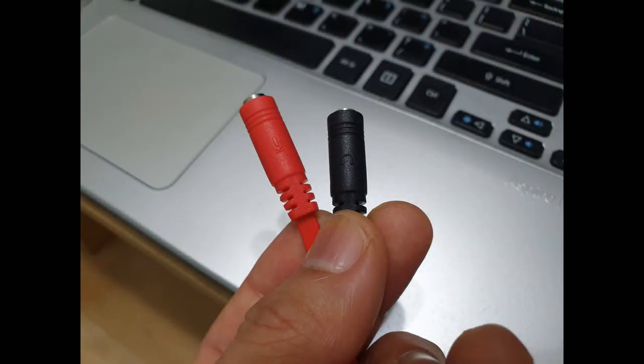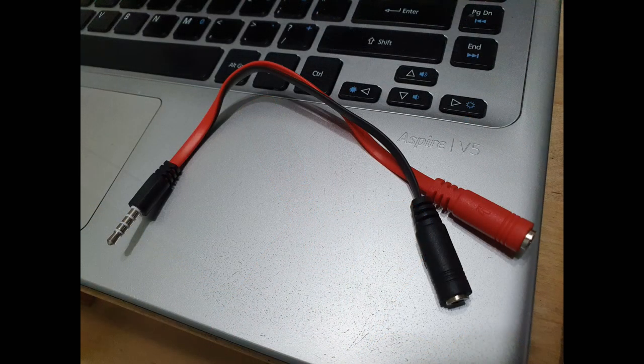The next most critical thing is to do your own monitoring without taking the 3.5mm plug in and out of the computer. Get a Y-splitter — I'll show you on screen. It's a Y-splitter that goes through your headphone jack, the 3.5mm jack, and then splits out into an input for microphone and an input for headphones. So when you do editing, webinars, or any kind of online sessions, you are able to listen to the audio coming in as well, because with the mic alone plugged into the computer there's only one way in and no way out.